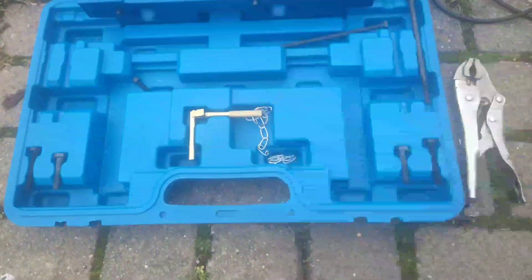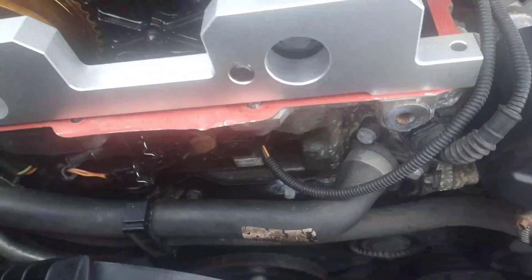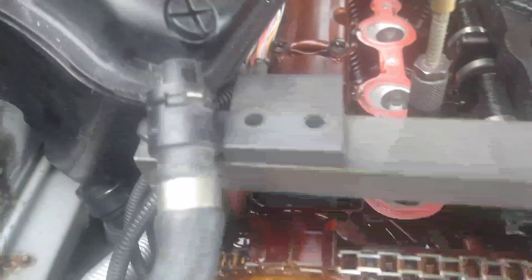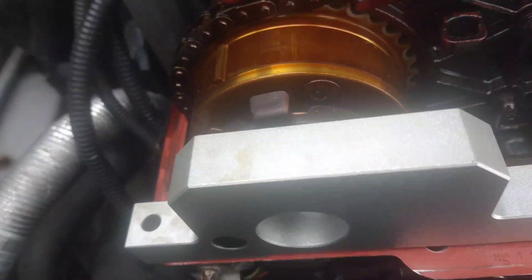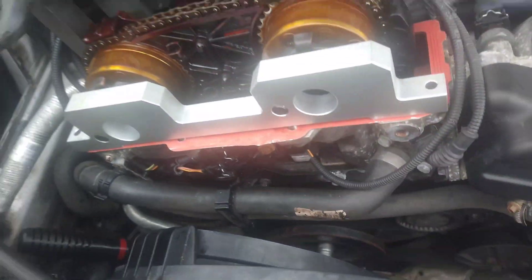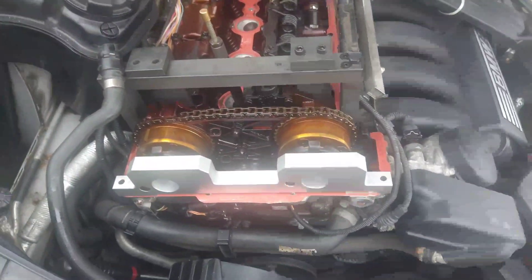Here's the timing kit that I'm using. I've put that in there - TDC mark on this one, I've adjusted it so that it's on 12 stripes coming up, because the pin is quite tight and it's awkward to get to. So I'm at TDC. This one lines up - that's the intake - and the dowel would line up. This one is not quite there. I can't get the dowel in either, so I'll see if I can adjust this cam. It did say it was out of alignment on the exhaust side and that's what the timing pins are saying as well.